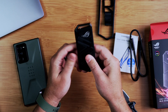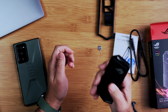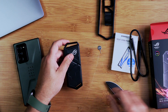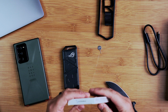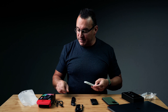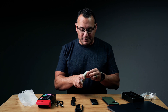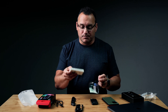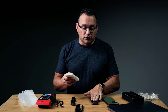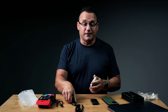The reason I went with this is not because I want RGB lighting. What I really wanted was a nice durable enclosure from a brand I was familiar with. There are a lot of brands that make NVMe enclosures, but most of them were USB 3.1. It was very hard to find one that was USB 3.2 Gen 2 Type C, and that's basically what I wanted — the best of the best. Because if you're going to spend the money to put an NVMe in an enclosure, you want an enclosure that can give you the performance the drive can actually put out.